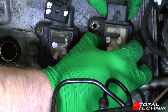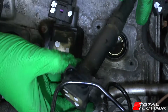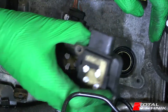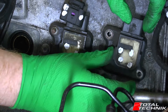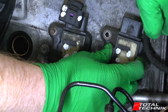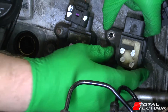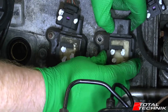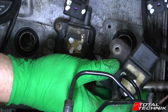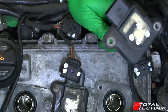Another easy one. You guys get the basic idea. If you do get a tricky one, just grab it under there on either side, and hook your finger under there for a little bit more leverage, and just pull it straight. Remember, you're not trying to pull it up — you're literally trying to pull it straight off that spark plug, straight in that direction. And that's how you remove your coil packs.